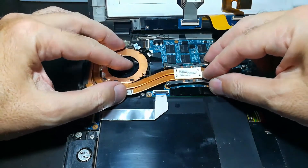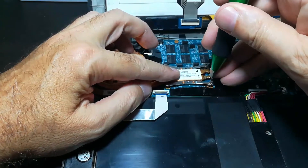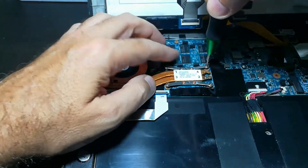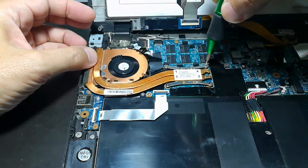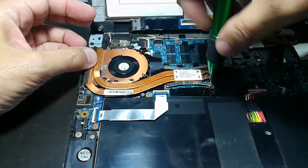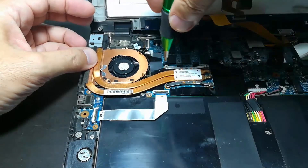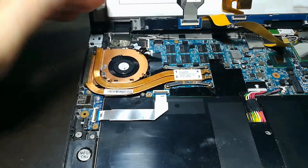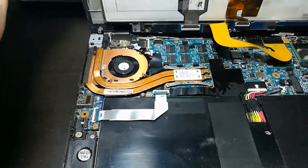I'm going to put that end in first and go straight down onto the screw end points. We'll get them all started and then go around and gently tighten them down like the way you do a car tire. This replacement fan is really well engineered — I like it a lot. These screws have a definite stopping point; you get there, turn it, and then it stops. And that's it — this is just held in by the force of the keyboard lid down on top of it.